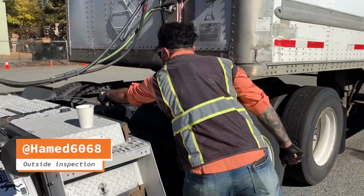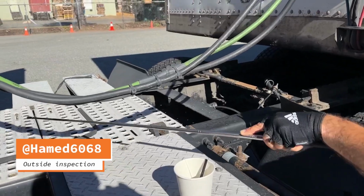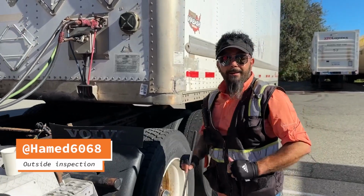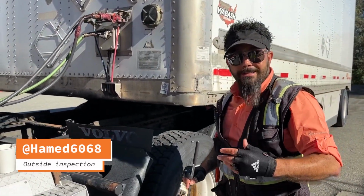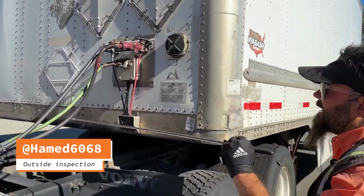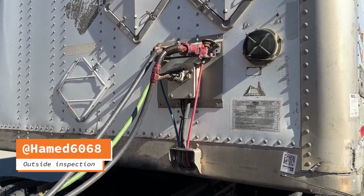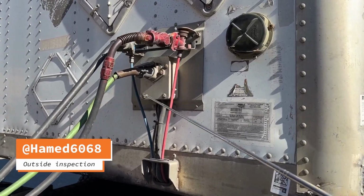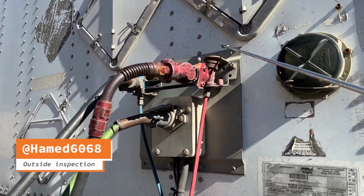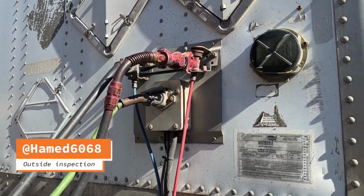The frame, cross members, securely mounted, not bent, broken weld, cracked, holes, or other damage. Air and electrical connection, number one. Air and electrical connections on power unit and trailer are seated, sealed, not damaged, and locked